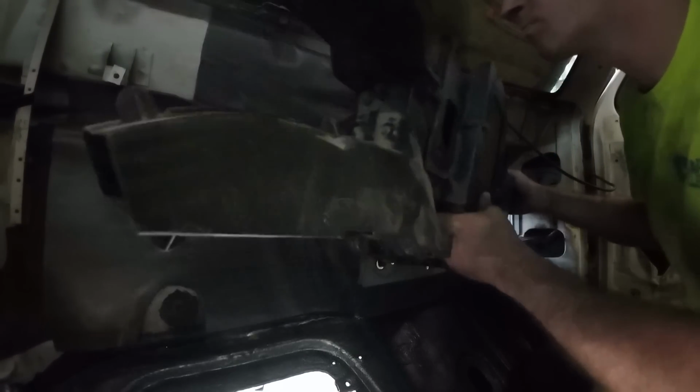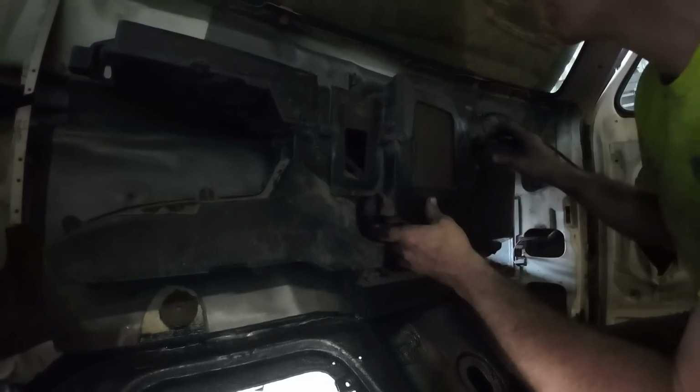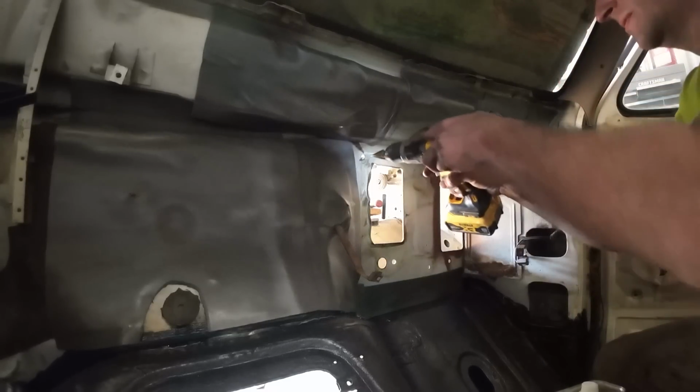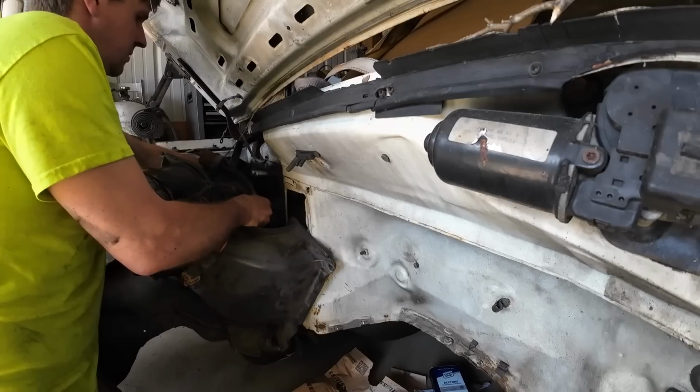We'll go ahead and try to slide this box into place. I did have to JB weld all the firewall through bolts in place on this heater box to make it work. Of course, it didn't fit, so that's fine. We're going to do the right thing there and just get the step bit out, widen those holes out. Should be fine. Shouldn't be an issue there at all.